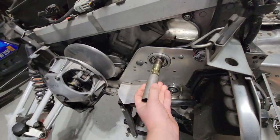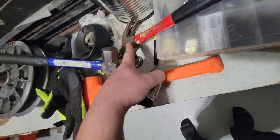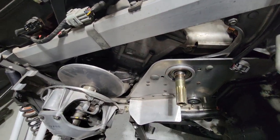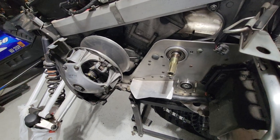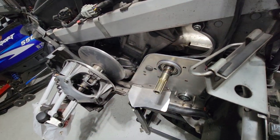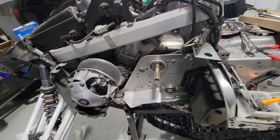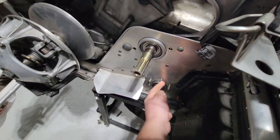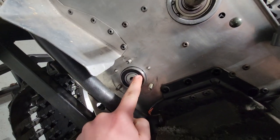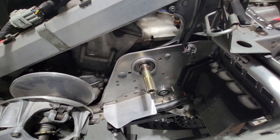We had this on there and then had a hammer put flat on it, just absolutely wailing on it, and it was not going in. I got on the Yamaha Apex Owners Club on Facebook and they said yep, you need the correct bearing — you have to have an OEM Yamaha one because aftermarket ones don't have enough of a taper. These are Koyo bearings, they're good bearings, not horrible, but this one here has an oblong taper — that one's okay, but this one's not.